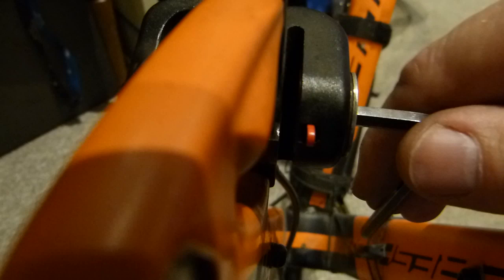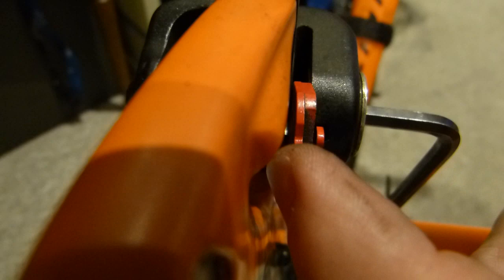If you rotate the piston forward there, you can see now the edge of the new brake pad material appearing there. That's maybe a little too much, so back it out a little bit, just initially, and only for initial assembly. I want a nice big wide gap. If you put the other side in first, then this side is not going to fit in no matter what you do. So now the other side doesn't want to go in, because you need to loosen one more bolt, which is the same wrench, which is right around there. I know you don't see it, because I need to get you higher.